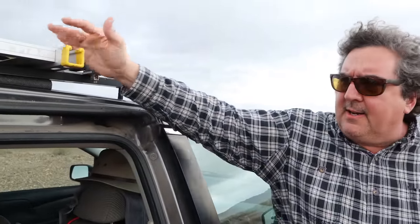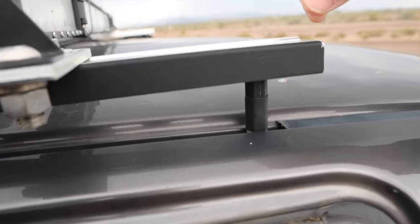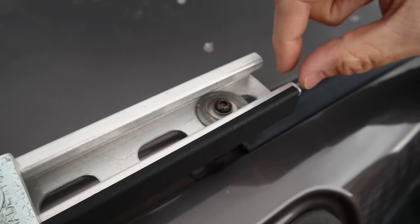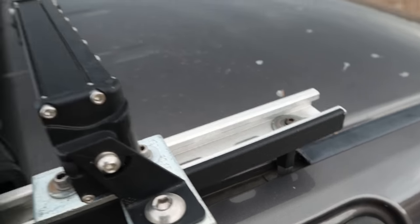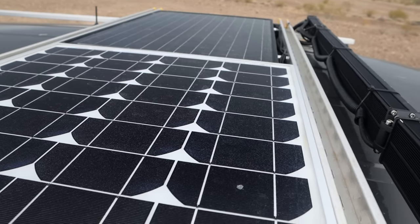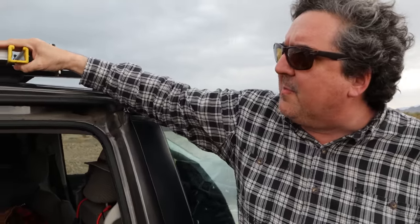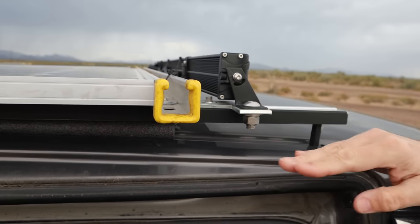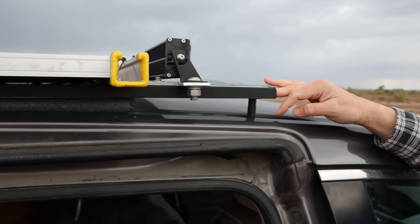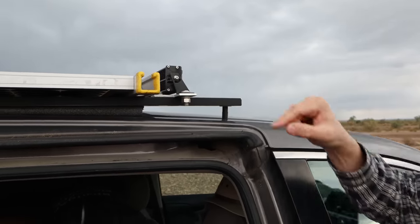When it came time to mount my lights and solar panels I didn't like the way they sat on the standard rack that comes with the Odyssey, so I built my own out of half-height unistrut — aluminum strut with M6 standoffs. They have a locking system where anything you want to bolt to it you can push the connector, rotate it, and tighten it down — it locks under the lips and holds quite a bit of weight. It holds my lights and also the solar panels. Eventually there will be a basket on the rear portion. The solar is held in a frame made of full-height unistrut, and I wanted to get the whole thing down as close to the roof as possible for aerodynamics, which is why I went with the half-height on the main structure.